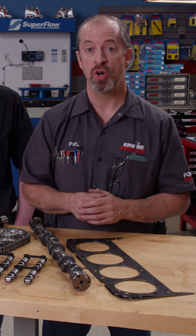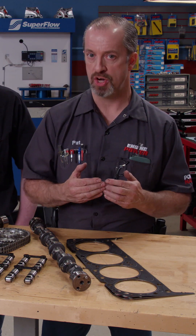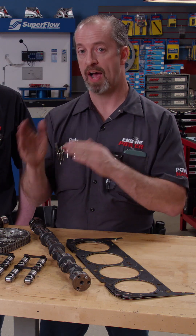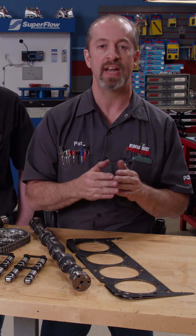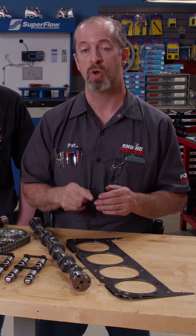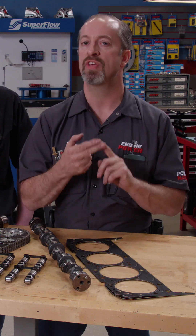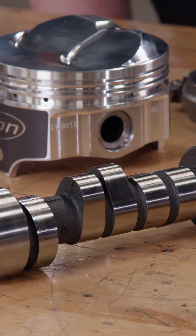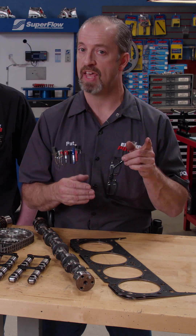It's time to put a cam in our engine, which brings us to why we are doing this entire operation — adjusting dynamic compression ratio. A lot of the time, people get hung up on just static compression ratio to determine the octane and fuel they will use, when dynamic compression ratio is just as important as static. It is calculated the same way, but you have to know a couple of different things about your engine: the connecting rod length, and where the intake valve closes in the cycle, which is directly affected by the camshaft. To calculate dynamic compression, we have to use something called effective stroke, which is the amount of stroke left after the intake valve closes.